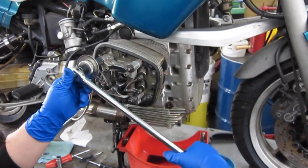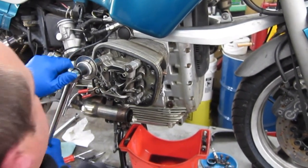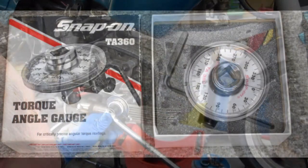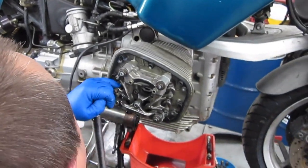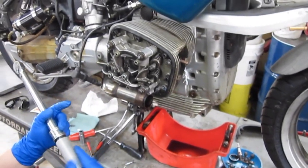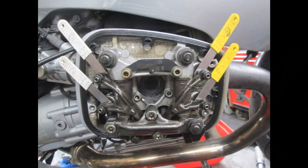Basically turning the nut another half turn — angle torque. A lot of things are done with angle torque. After those four are done, there's an M10 bolt you're going to hit at 40 newton meters, so that would be loosened and then torqued to 40. That takes care of that cylinder retorquing. You would then adjust the valves, move on over to the other side.